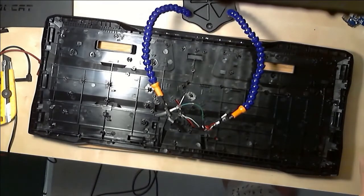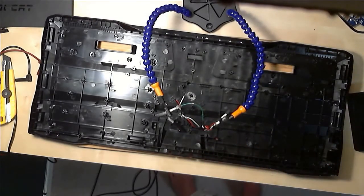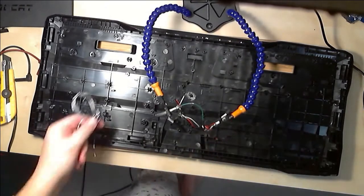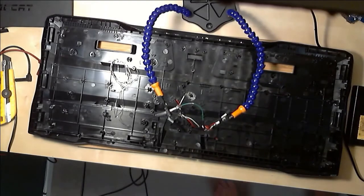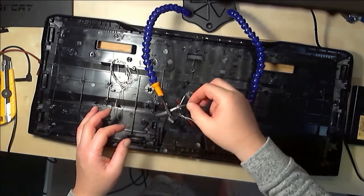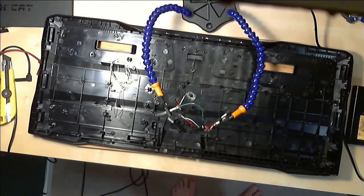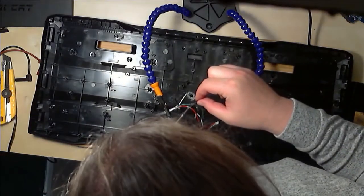So I've skipped over stripping the wires and sliding heat shrink down on the individual ones. I've also got a big lump of heat shrink on the clear cover for the USB. I fed that through the hole in the center, and that is going to give us the stock fit and stock location — it's going to work exactly the same. My third hand there — that weird-looking doodad holding the wires — I just got that on eBay. They're like $25. What a score. Absolutely great to have. If you've done any electronics work without it, you can appreciate what it's like trying to hold two tiny little wires in one place with one hand and solder with another, and somehow hold the soldering iron. It's ugly. But now I don't have to do it like that anymore.